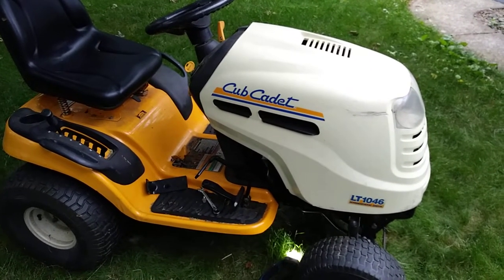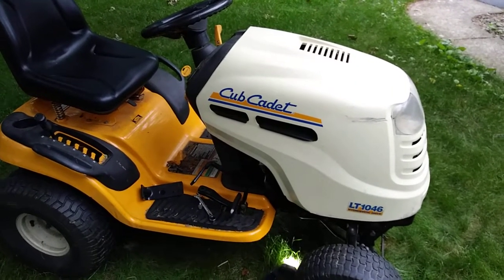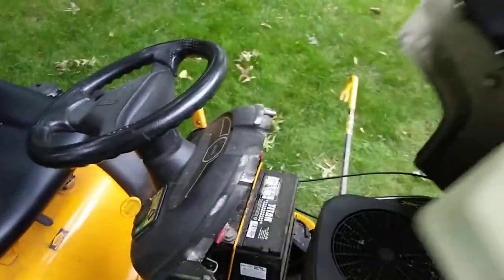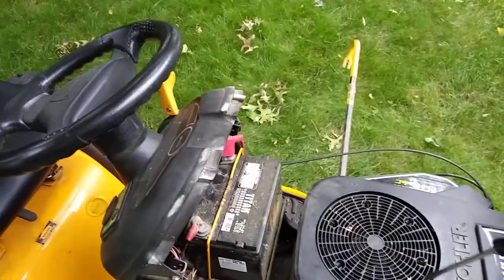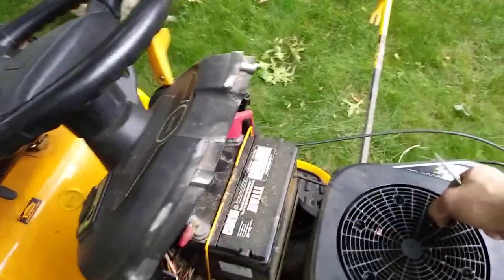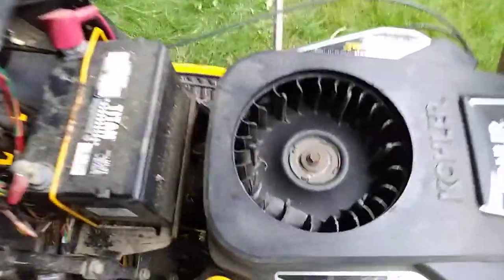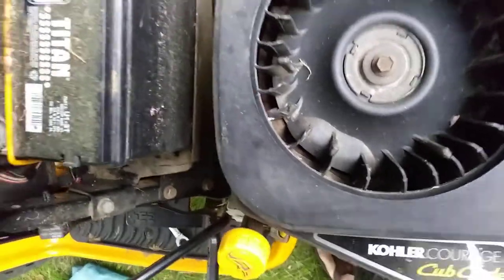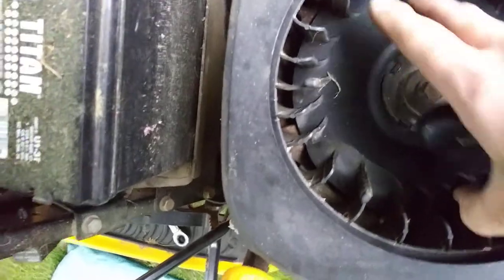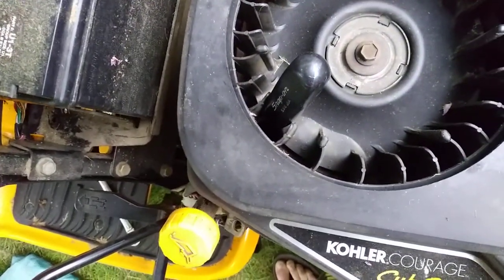The quick tips that I found that made this a lot easier, even though it was a pain: the removal of the nut can be pretty easily accomplished by removing the screen. There's a counterbalance on the flywheel that you can get down in and with just a screwdriver — you get the screwdriver in and lock it off, allowing the bottom nut to be removed.